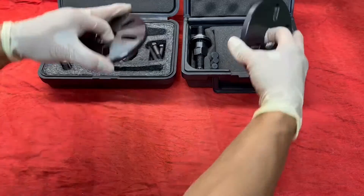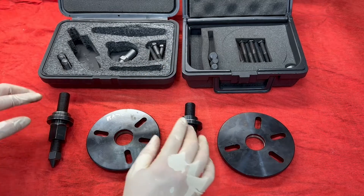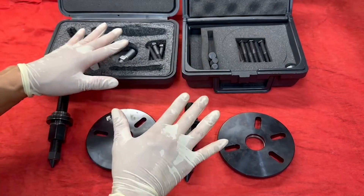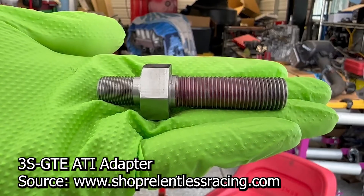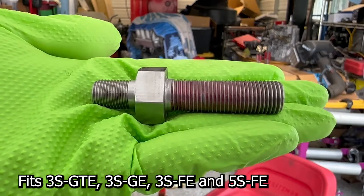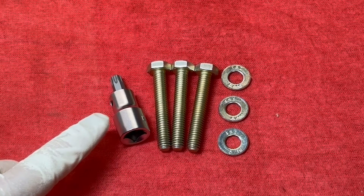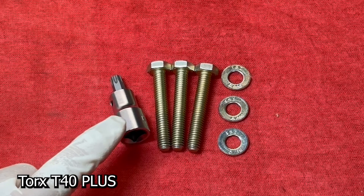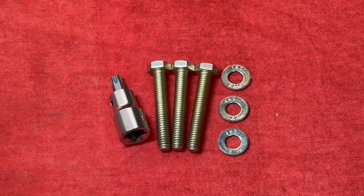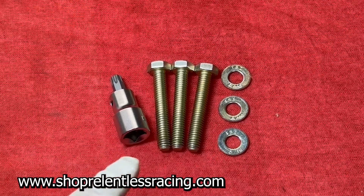They both come with base plates, center shafts and drive nuts. They also come with three crankshaft adapters. But the key to these particular tools is they were designed for domestics and not imports. So I designed this crankshaft adapter specifically for the 3S GTE, 3S GE, 3S FE, and 5S FE. Additionally, you will need a Torx T40 Plus bit — not a regular Torx bit, it is a Torx T40 Plus bit, they are different. Please don't use a regular Torx bit because it will mess up the bolts in your ATI Super Damper. You will also need some 5/16 inch hardware, and I've bundled these items together and they are available on the website as well.